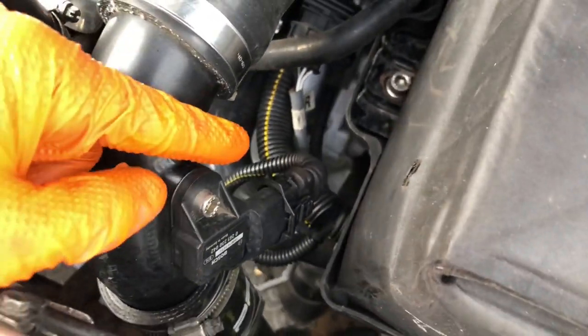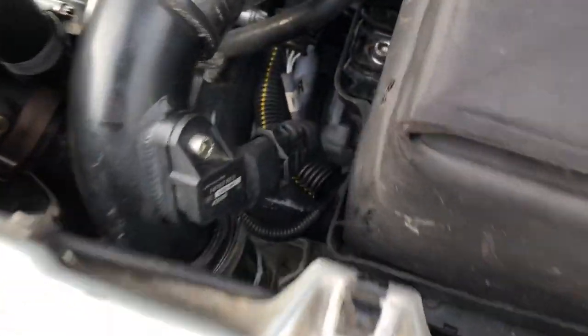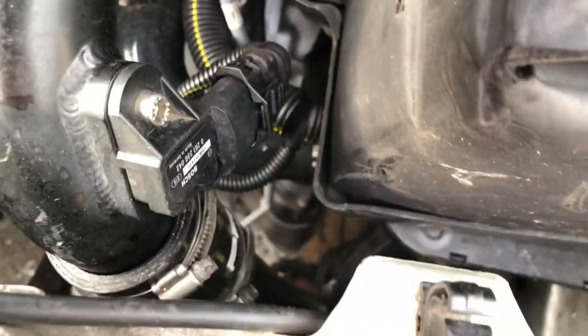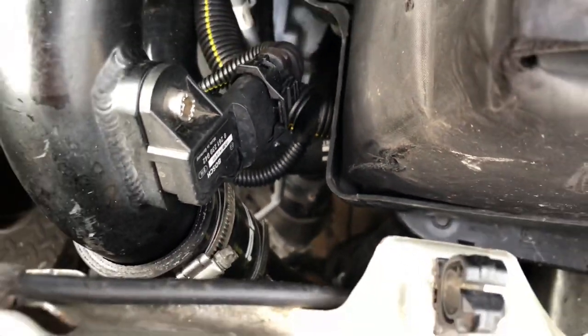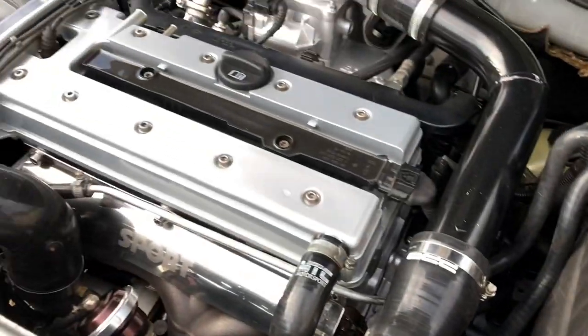You can hear right now I'm just bleeding the coolant system. Just leave the cap undone, turn the auxiliary water pump on which is down there, and let the air bubbles get out before you try to even start it up. You can hear it pumping away. On the race cars we don't really use them that much, but on the road cars we always do because in traffic it spins faster than the water pump and stops your car getting hot.